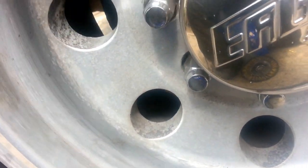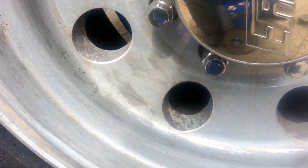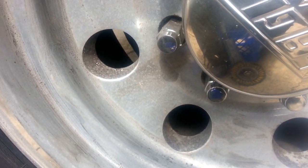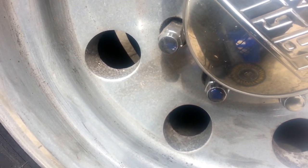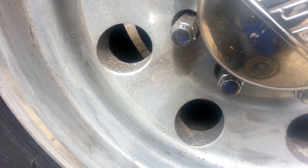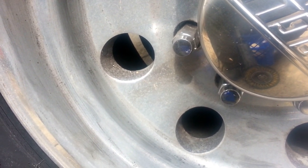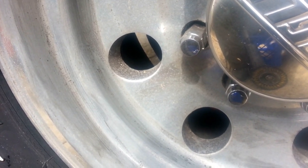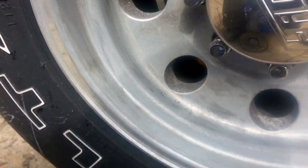So anyways, we're just going to start shining this up. We're going to apply the rouge lube with the steel wool and then start buffing, okay? If it gets to be really bad, I will just cut the rouge lube off without applying any stick. After I get the initial cut, I'll come back and apply the stick to the pad, that yellow bar, to the pad, and start cutting again. Just take notes.